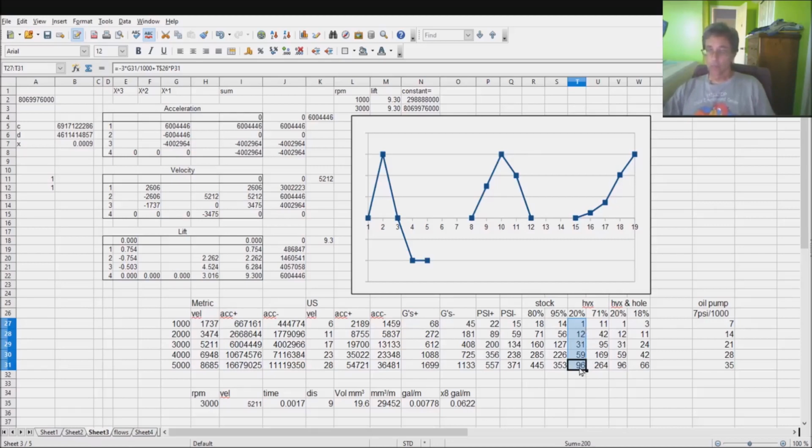This is what you get when you expose through that cut in the lifter. You've got some oil that's trying to push its way out towards the head. That comes from the oil pump over here. And then you've got oil pressure coming from the motion, which is these guys over here. And with the oil pump pressures, say 7 versus 22, the oil pressure over here at the pump is going to lose every single time, which means that as they get higher in RPMs, the pressures are going to go up.